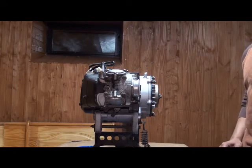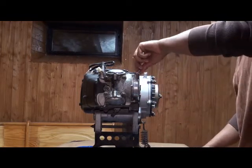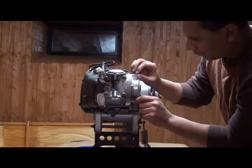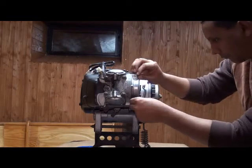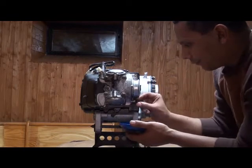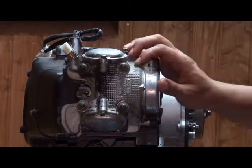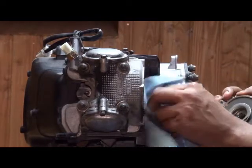On page 5-5, we're going to remove the breather and the O-ring using the 8mm wrench. I haven't messed with this yet so all of these are going to be kind of tight. There may be a little bit of oil that comes out of there, so you want to have some rags handy to catch that oil. Not too bad because I've had this one draining for a little while.